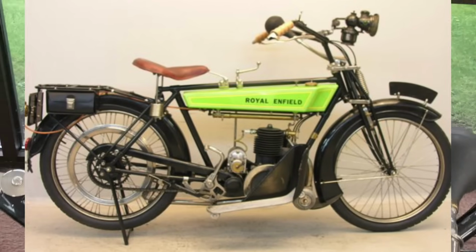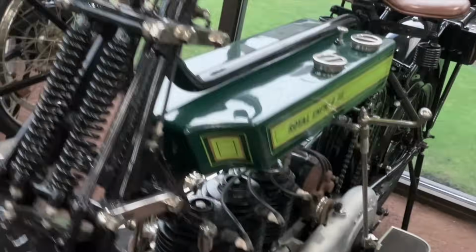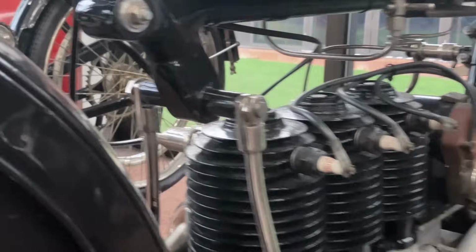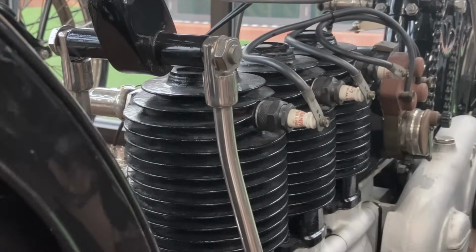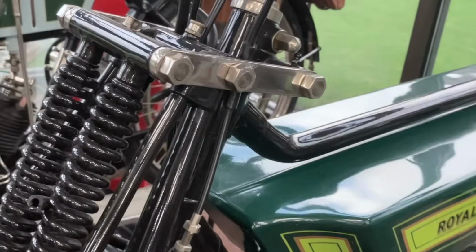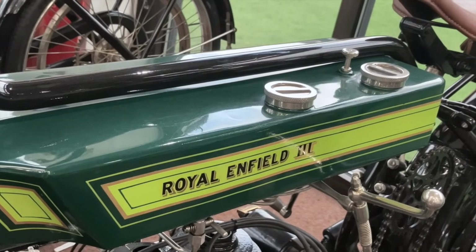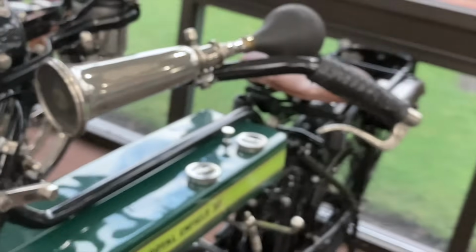The engine was a fairly conventional deflector piston 2-stroke, but did feature roller bearings, had an external flywheel and a 3-speed transmission. Power was then fed by a chain to the rear wheel, which featured a cush drive, something which Royal Enfield pioneered. In the single-cylinder form, top speed was around 35 miles an hour, so it was reasonable to expect that the 3-cylinder engine would have put out somewhere around 7 horsepower and gone around 55 miles an hour, had it been produced of course.